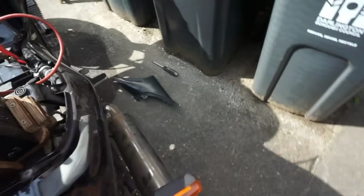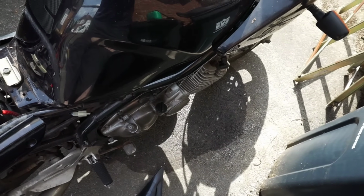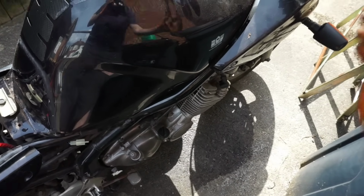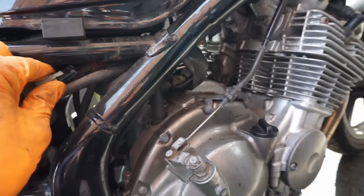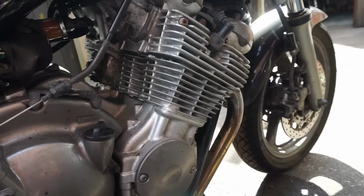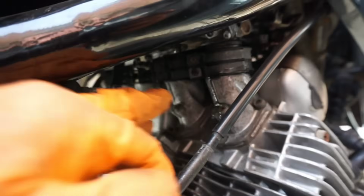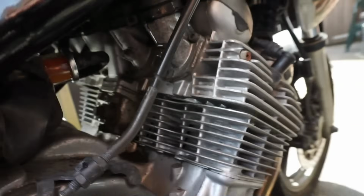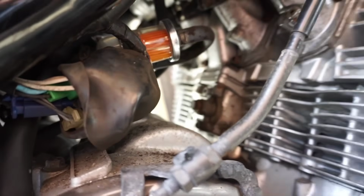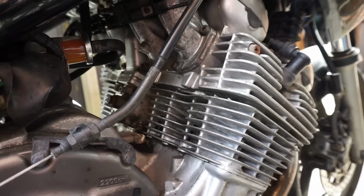Okay, I might have to put the fuel pump back on because it's not got enough fuel. So if we can keep it going, we'll put the fuel pump back on and just watch for any leaks over this side. If I see any leaks, I'll pull the fuel pump off. Yeah, it's leaking out already. Pull that fuel pump, it's almost like it's coming out of the intake there. I'll just double check that screw. It did tighten them up, I think. Yeah, that's tight. It's obviously got a significant leak for it to leak out of the float bowl straight away, so very strange.